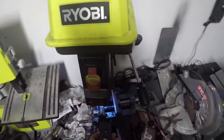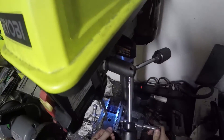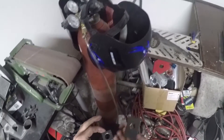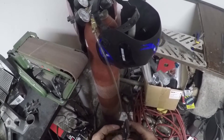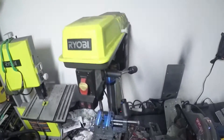I got these bored up to around 7/16 and that's pretty much all I have to work with, and then we're taking them up to 5/8 inch with this 5/8 inch bit. We're making some mounting tabs — we've got this one that bolts up to the bottom, then we're going to weld this here, have a bolt through there, and this is going to hold our lower control arm.